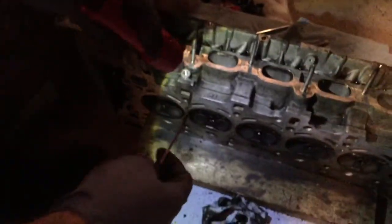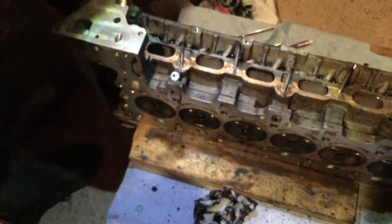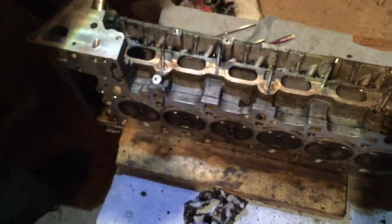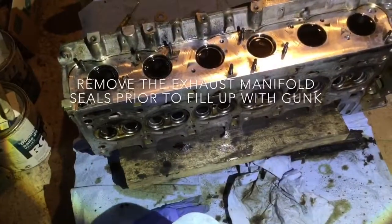Also, there are the 2 holes where the valves are in. You just take the screwdriver and swipe. There's a lot of dirt coming out of there. And then you just look from inside the intake where it goes down to the valve. And sometimes you just need to swipe a bit with the rag, and that's all. Okay, so